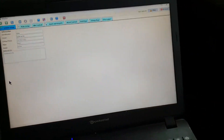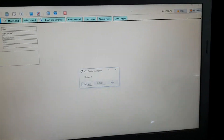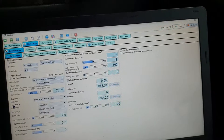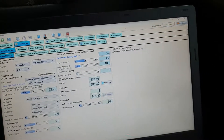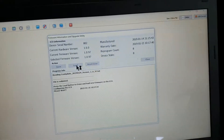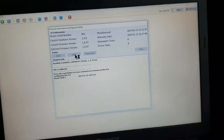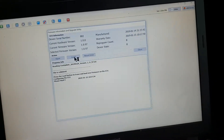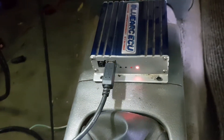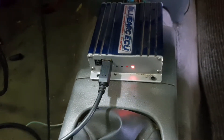Switch on the ignition. The USB is already connected. Read from ECU. Then we update the new firmware, because the new software has got new firmware that works with the software. Updating the firmware will put the blue arc in that state, and at the moment nothing else can happen — it's busy with firmware.